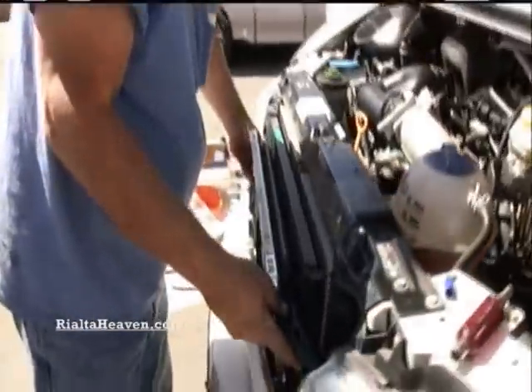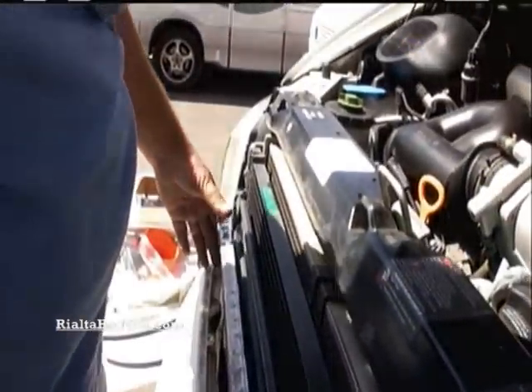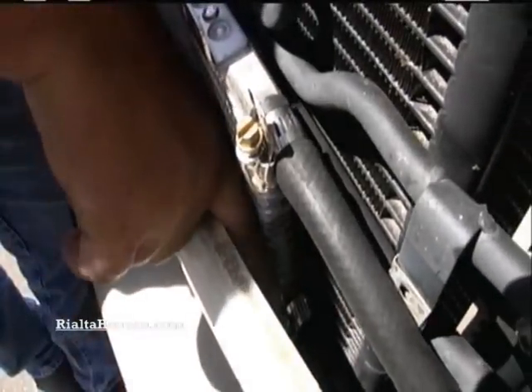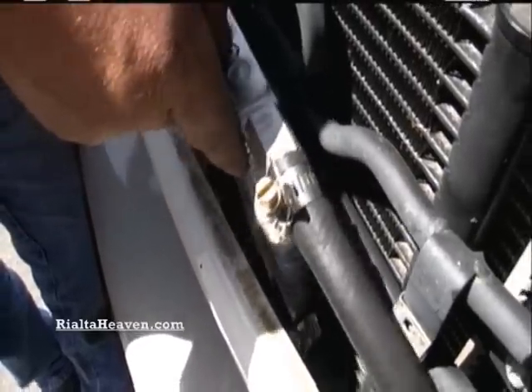Mark a spot and kind of wiggle to get the hoses down in there and get the cooler seated. Don't force anything, just take your time. You're going to realize that putting it in there it stops — that's because the bottom hose clamp is catching on the grill, on the plastic work, just to the inside of this little support on the grill.